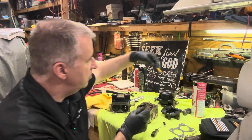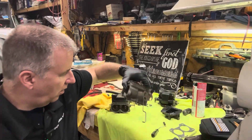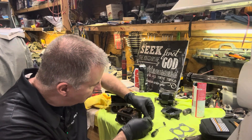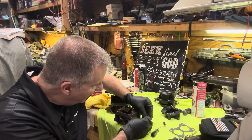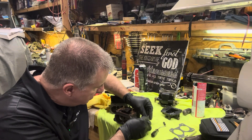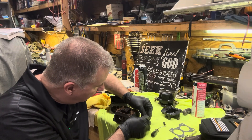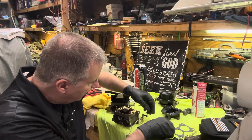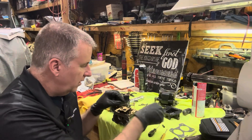This follower just takes a little screwdriver. There's an O-ring on the end of it, and that O-ring is the only thing that holds it on, so we don't want to lose it. I try to pry it off without breaking it or losing it. You've got to make sure you get underneath it real good — sometimes you drive the screwdriver right into your fingertip. It takes a few tries, but we roll this sucker off. Finally got that off. There's the old follower.